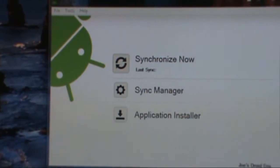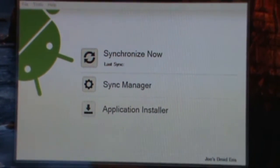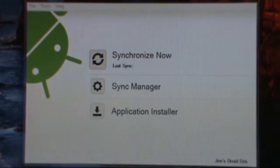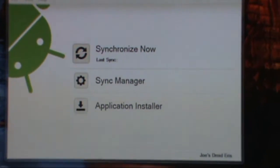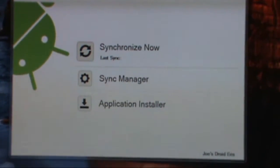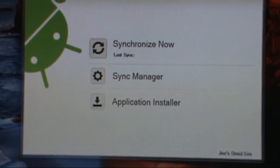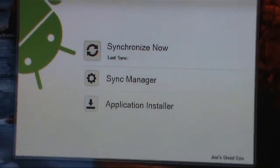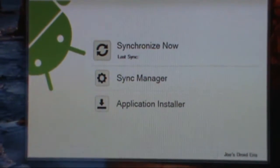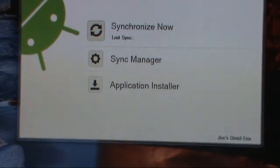Just make sure the drivers you're getting match your operating system. If you have Windows 7 64-bit or Windows 7 32-bit, the Vista 64 or 32-bit drivers will work as long as it's the right version. If you have a 32-bit Windows 7, use the Vista 32-bit drivers. If you have a 64-bit system, use the 64-bit drivers. It doesn't matter that they're Vista drivers — it just matters that you have the correct 64-bit or 32-bit version.